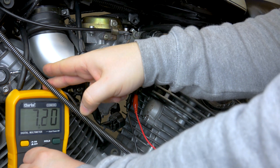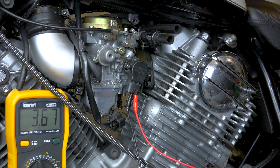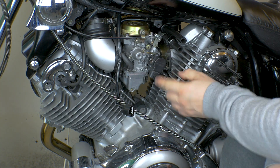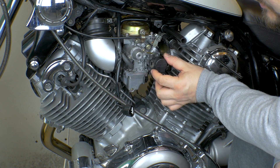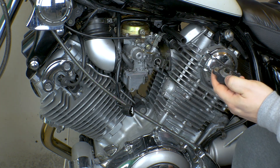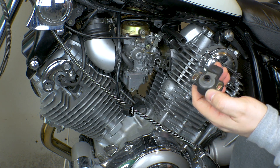Mine is on 2k but it's going up to about 4k. Back to 20k and just keep opening it — it's 4,280 altogether. That's basically how you verify it's working. When you've got the bolts out, just gently wiggle it out. It's got a rubber seal inside there, so make sure you don't rip it out. That's your throttle position sensor — a very expensive part, so look after it.